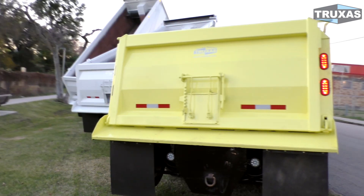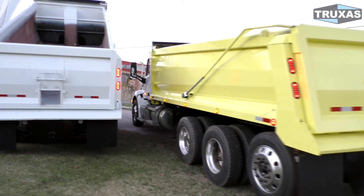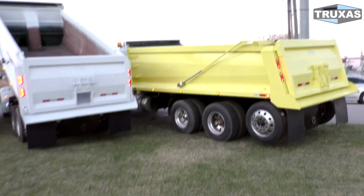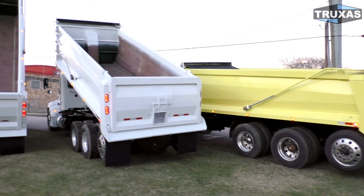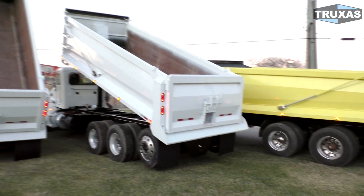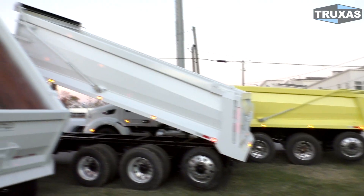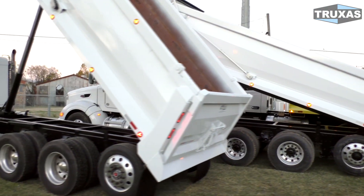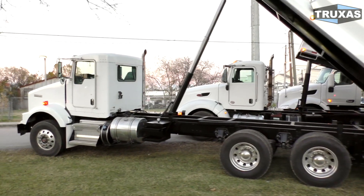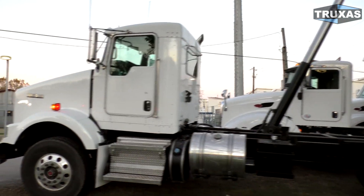The main difference between this truck and the one that hauls 19 tons that we sell new is the length — it's about two foot shorter — and these ones have big block engines. They have 15 liter engines, which weighs about 1,800 pounds more than the 9 liter that we order in the new SuperTag dump trucks. So you add those two things together and you're hauling just about two less tons on these — so instead of 19 tons, you're right at about 17 tons hauling.